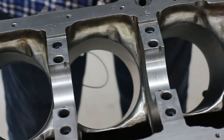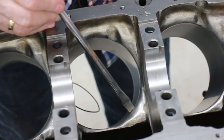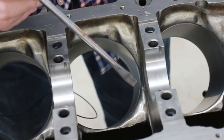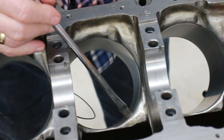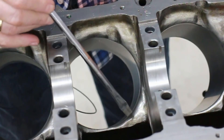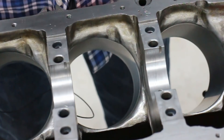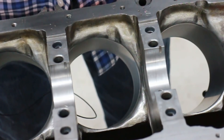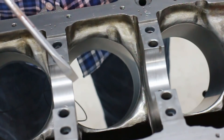What I want you to notice here is how I've blended the bottom of the bores and rounded them off. Very often people say you need a sharp edge there to shave the oil off — that's BS. This rounded edge allows air to follow the piston up the bore easier, and rounding it off and blending it all in on an engine like this at 7,000 RPM is worth six or seven horsepower, and it's free.